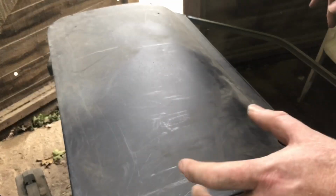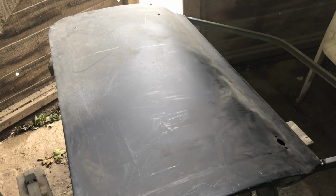because in the end you can still tweak it, which is good, because what you can do is get it all in the car. If it needs a bit of twisting, you can twist it while the door skin's still a fraction loose. Once you've got the right curvature and the door twist, a couple of tack welds on the back ain't gonna twist no more easily.